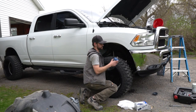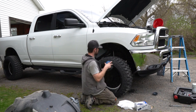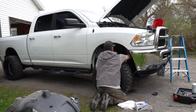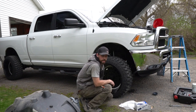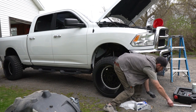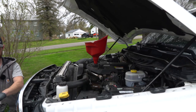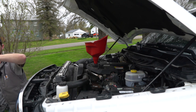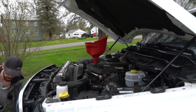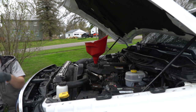You don't have to have the cap that tight to put the new filter back in. I couldn't get a good seal on the old filter which is why we made a little mess pulling it out, but right now the new one isn't that snug — still loose enough to get it out with one hand if needed. New filter's in there, we didn't make a mess. I'm going to pop the cap off, get the wrench on the bottom with the ratchet, and tighten it down. We're going to start by pouring in the two-and-a-half gallons — that's 10 quarts — we already have one quart in the filter for 11 total, then one more quart from the other jug to equal 12.